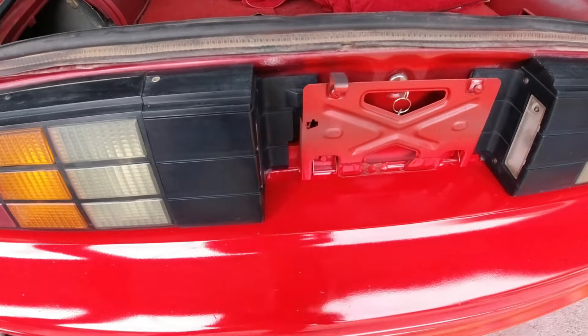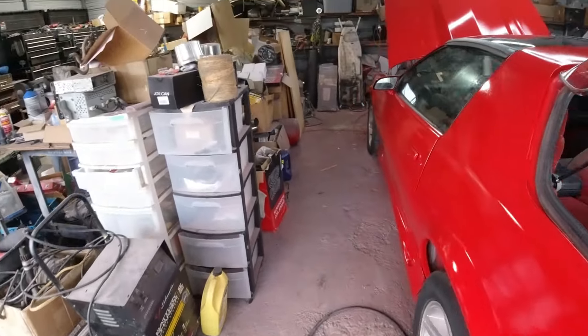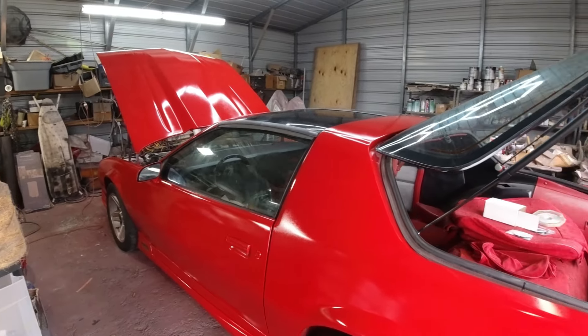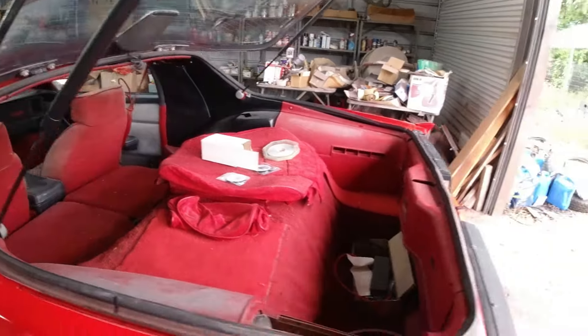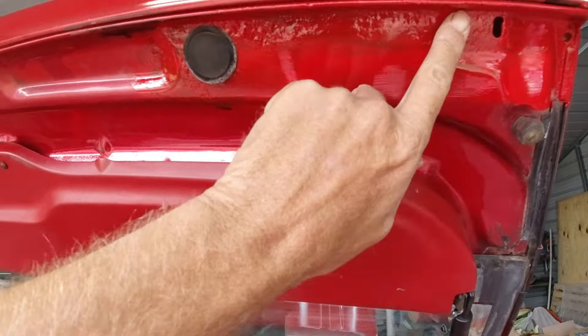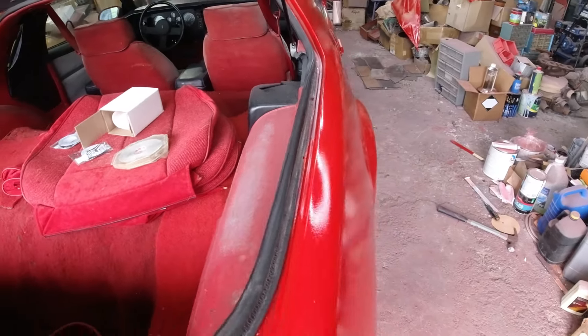There's just a bunch of stuff here from when I unmasked it — not very much trash, dirt, bugs, or anything, really just a couple little spots. Cleaning it up and putting it together. Put a little black here, put some red on with a brush where it was rusty and the maroon paint was flaking off. I put some POR-15 there and then brushed a little red paint on, same with where I had to weld in that brace for the spare tire.